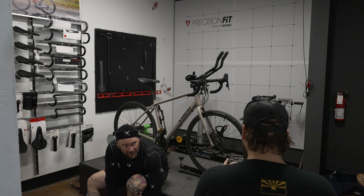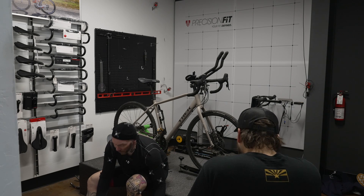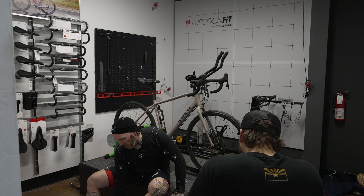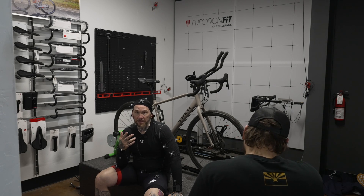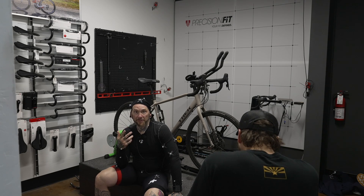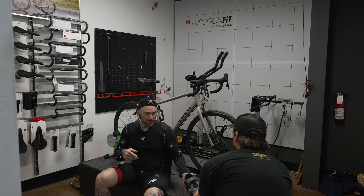We are right in the center so it looks like we've got plenty of room to adjust that cleat. For those of you who ride clipless, that adjustment on your cleat makes a world of difference — it'll be the difference between hyperextending your knee or being flexed too much. It could cause or be a factor in your knee pain if you're experiencing it when you ride. It's best to check the fitment of your cleat and shoe in relationship to your knee and the arc of the stroke.